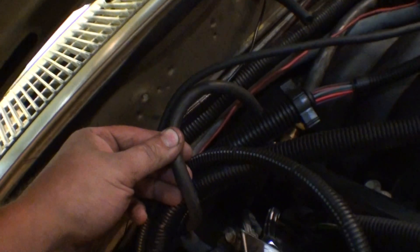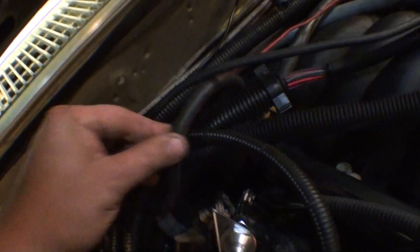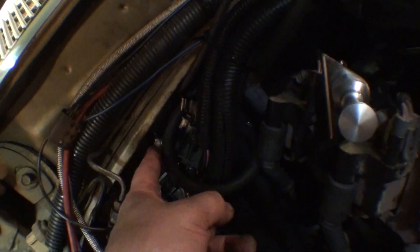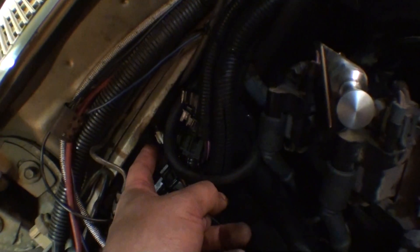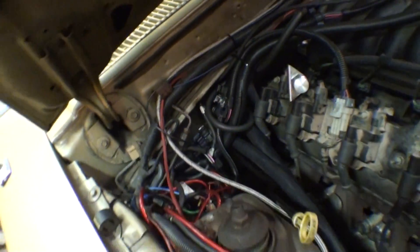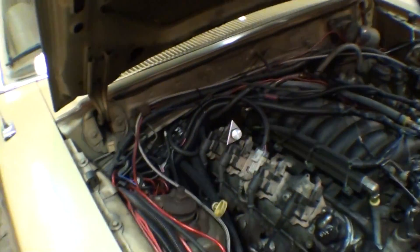This is from the back of the intake manifold — it's this vacuum hose. It goes into some T fittings, and that's how it goes into the MSD box. The MSD box can see boost and move timing around. The other one goes into the car to my boost controller — I want to make a vacuum tree.